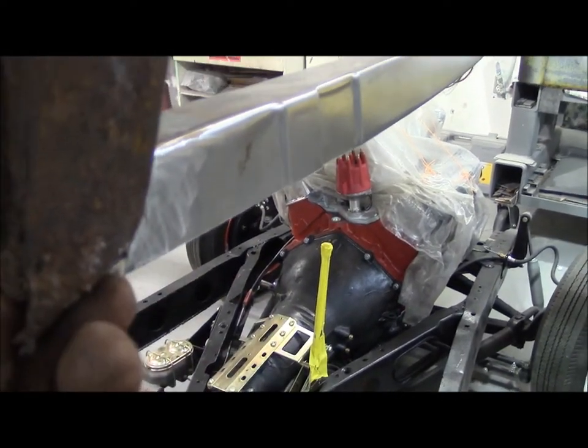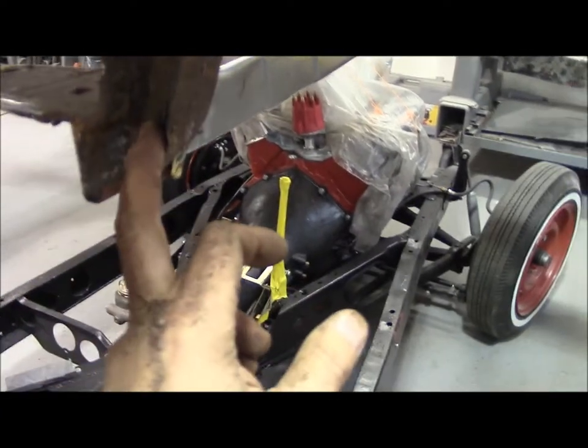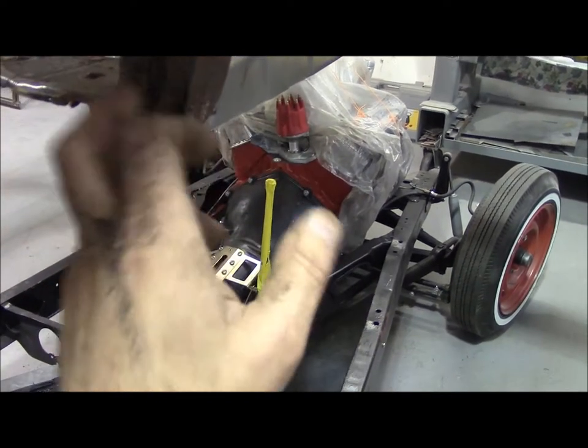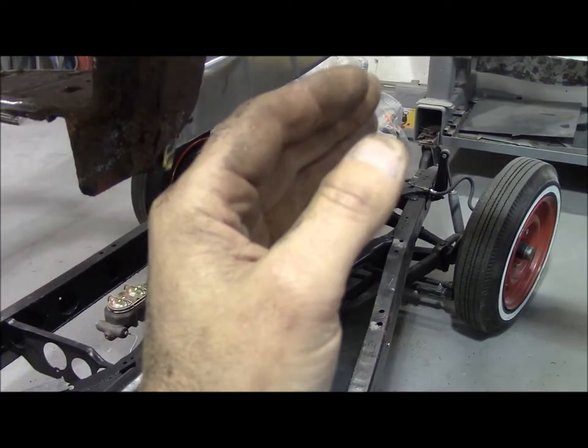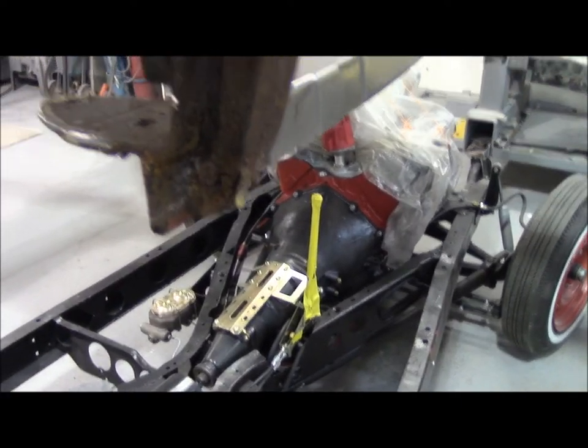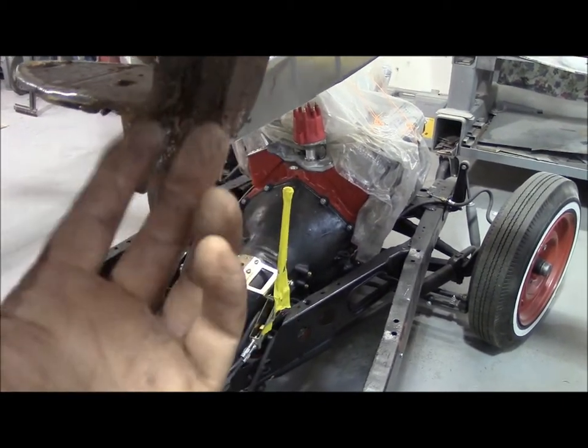Some people, some shops, they may just grab this panel and jam it up on there and say 'hey, I don't see the rust no more, let's weld the panel on, do the body work, paint her up, who gives a shit.' Well the problem is when you're leaving rust like this it's like a cancer — it's back here and it's already started. It's going to continue and spread onto the new panel. It probably wouldn't rust through to the new panel for another ten years or so, but if you got it this far apart, why wouldn't you just fix it?